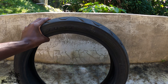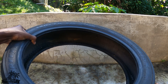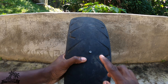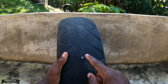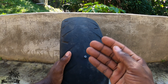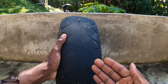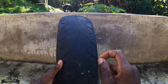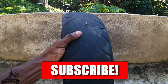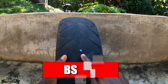This is my dummy tire, and it shows how it looks when there is a nail on the inside. Once you find where the hole is, if you cannot find a nail or a screw, what you can do is use water — spin your tire and pour water on it. Wherever you see bubbles, that's where the hole is.